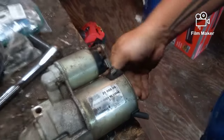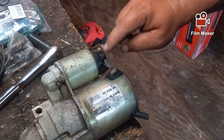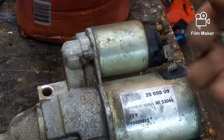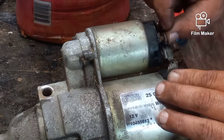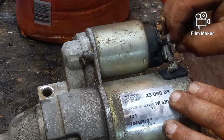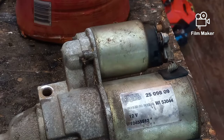What I need to do is put it back on. I need to find a nut that'll fit on that solenoid post so I can put the battery side back on correctly and the key switch wire to the trigger post. I found a washer and a nut that will fit on the contact post. There's a little lip that sticks out so I put a washer on there to give it some space so when I draw the nut on it'll clamp the wire properly.